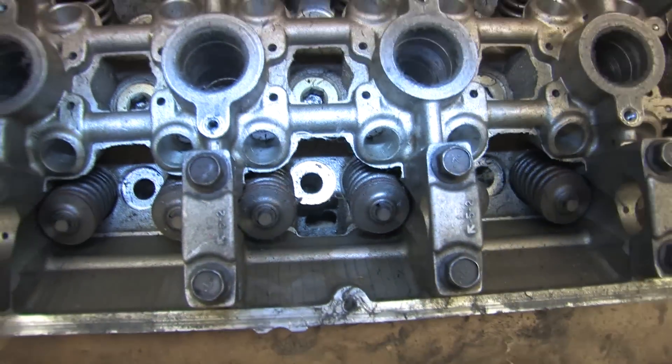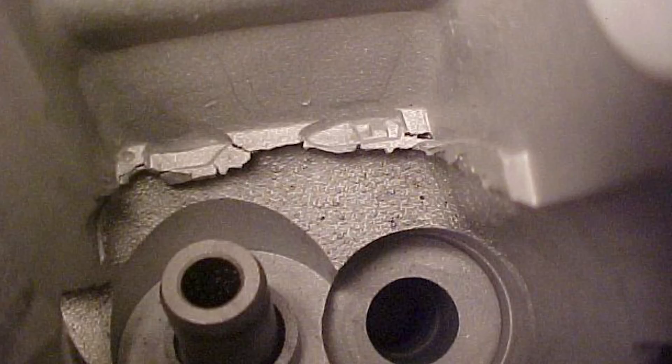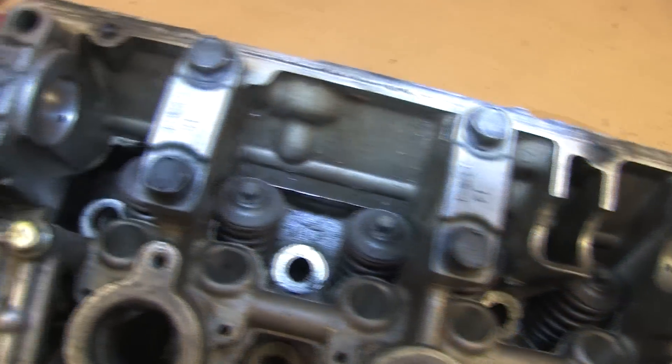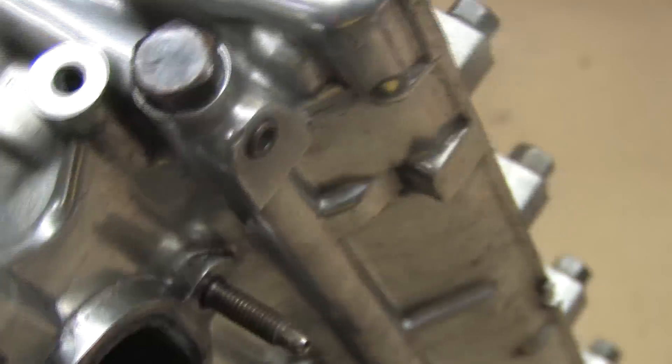The areas you should pay attention to the most is what lurks under the valve cover and inside the oil return galleries. You probably don't want flakes of aluminum breaking loose and ending up in your oil pan — that in my opinion is the worst of it. Half the cylinder heads I've handled have had these kinds of simple problems. When the DSMs were hot commodities at dealerships, there was actually a shortage and Mitsubishi had to rush production to meet demand. This is a byproduct of that scenario. A little bit of time deburring this would have been a good thing, but it would have cost them time and money, so since it wasn't done when it was cast and built, I did it myself.